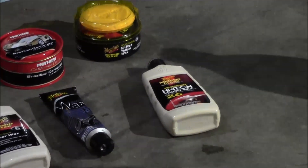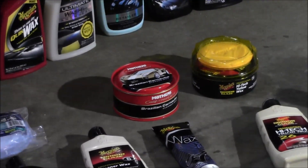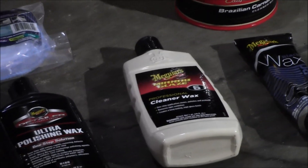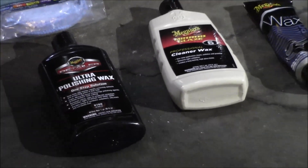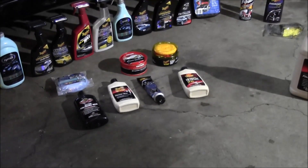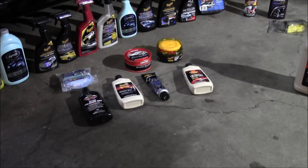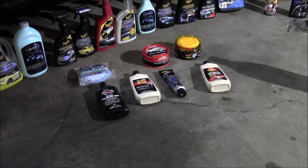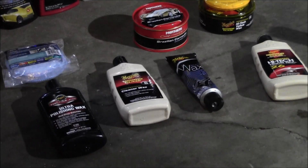I've got the High-Tech Wax liquid or paste, Mother's cleaner wax — that stuff is really awesome. This side is pretty much cleaner waxes: the black wax is a cleaner wax, the M6 cleaner wax is a cleaner wax, and the D166 also falls into the cleaner wax category. The question between a pure wax and a cleaner wax boils down to whether you want a polishing effect from your wax job. A lot of times these cleaner waxes are pretty similar to a clay bar — they'll rip those bonded contaminants off the surface. Clay is definitely a better way to do that, but if you're not into clay, pick up a cleaner wax and it should knock those contaminants off.